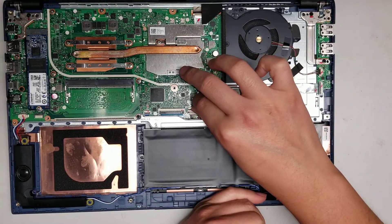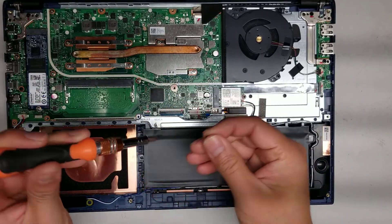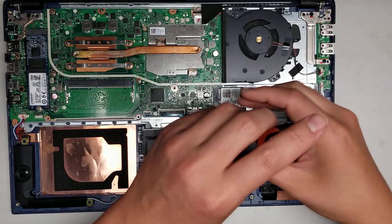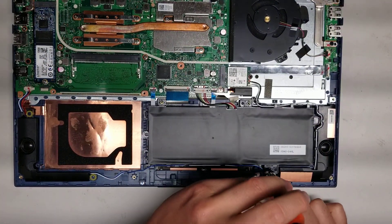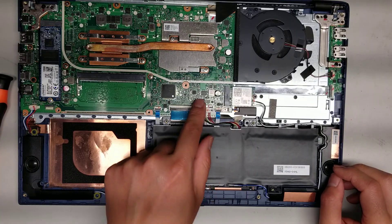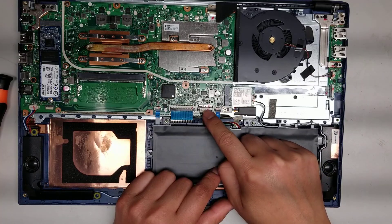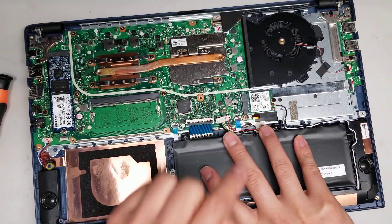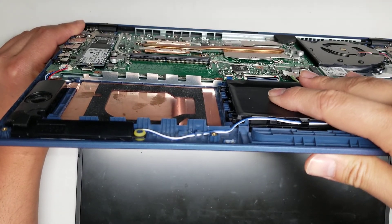To remove the battery — which is usually the first thing you want to do once you open it so you don't damage anything — there are three screws at the top: one black screw and two silver screws. Keep them in order. Remove those, take the bracket off, and there's one more screw down below. To disconnect the battery, there's a silver piece you slide upward with your fingernail, then lift the connector out. Once you do that, hold the power button to drain any power from the board — 30 seconds to be safe, though 5–10 seconds is usually enough.